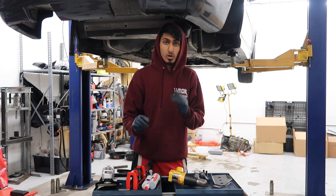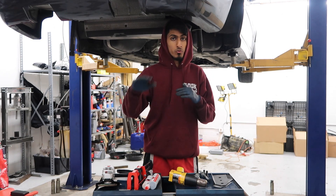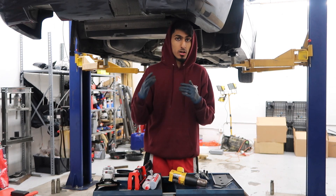The epoxy takes about 24 hours to cure before you can reattach your subframe. What I suggest is to go ahead and remove your rear end first, then epoxy the plates in and continue removing all the bushings and changing them out on your subframe. You're also going to need some kind of paint or undercoating so that any other bare metal exposed after epoxying can be painted to prevent future rusting.